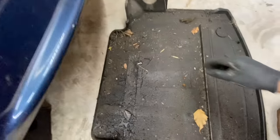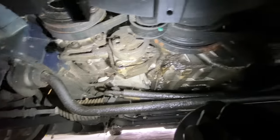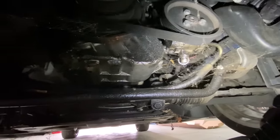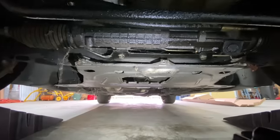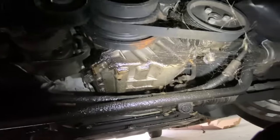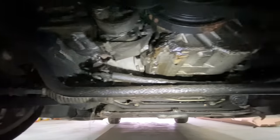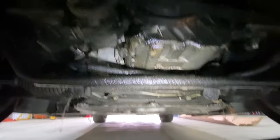She's pretty dirty. The bottom side doesn't look any different than a comparable E46 — potential oil pan gasket leak over time, maybe a power steering leak over here too. You don't really know until you pressure wash them off and get a good baseline. We're gonna get the thrust plate pulled off so we don't catch all the coolant if we do leak any, and we'll get a better view of this engine on the top side once we get that cooling fan out. The car looks pretty complete; the fenders are still there. The ambient temp sensor is gone and ripped out, but the car is in pretty decent shape. Let's get the oil out, get that thrust plate off, and keep going.